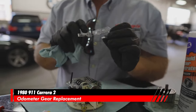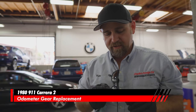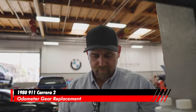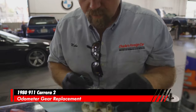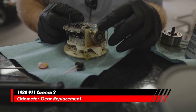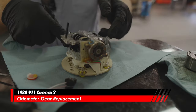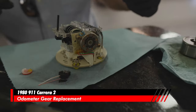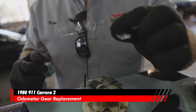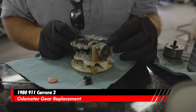This is like a fiber optic piece, so there's two bulbs at each end, and the light shines through it, and then it probably just backlights everything on that real nice. See how that's aimed right at each bulb? So there's a bulb there, and a bulb on this side. And the light flows through it and then it refracts off this piece right in here. And then it just directs the light outward.